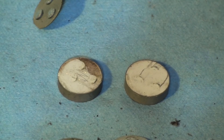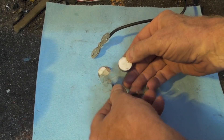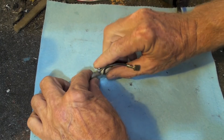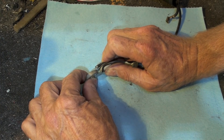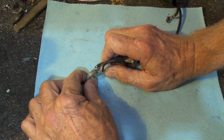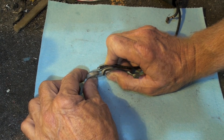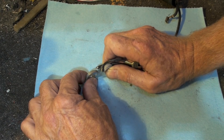Inside are the components that make this thing work — these buttons. They fit sandwiched between two wires: one wire going to start and run, the other going to the cap, which connects to the opposite of start and run. There's just continuity through there. When it's cold, continuity is present; when it heats up, the continuity goes away. That's all there is to it.